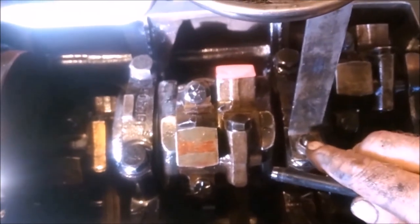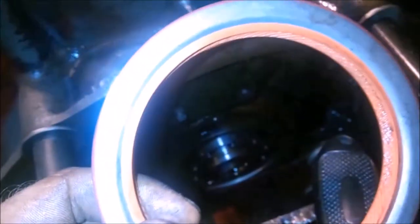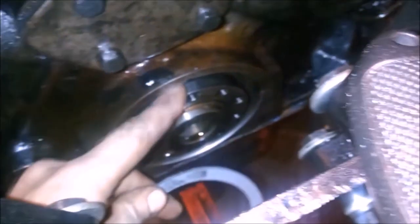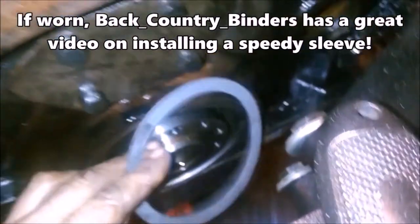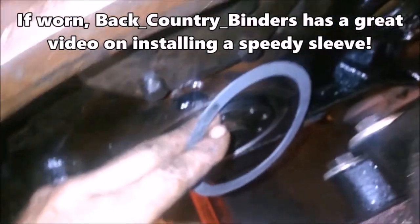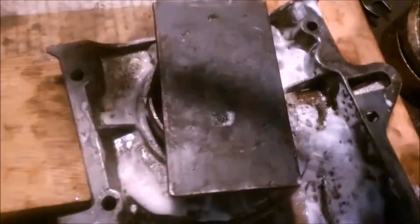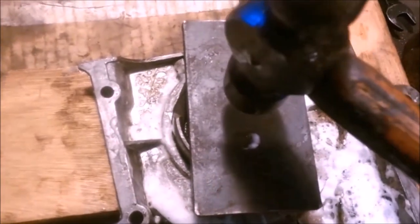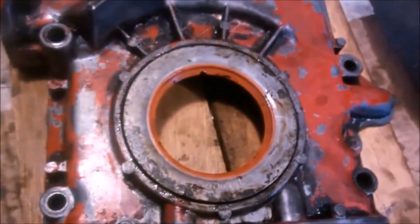Twist it back down onto this cap bolt — you'll need to take that off your four-cylinder if you've upgraded. Install our rear main seal in the right direction with the face outward. Put a dab of oil on the outside edge of the metal surface. It's going to seat in there up to where the chamfer is. They give you a gasket to put behind it to seat it if there's a groove worn there from a prior leak — the spacer puts it on a different spot. Tap the seal evenly on the ridge — we don't want to distort our aluminum cover.